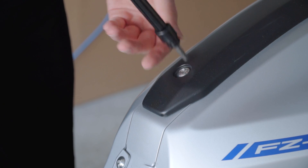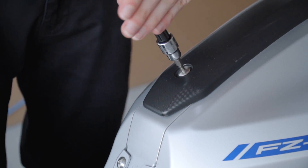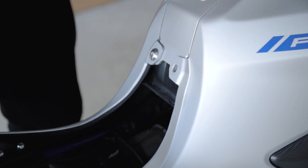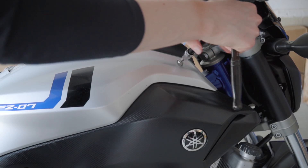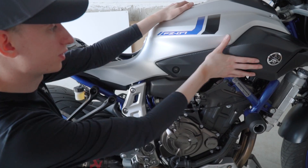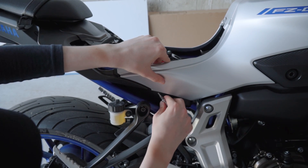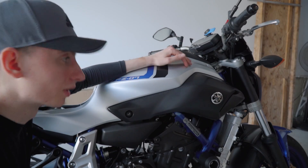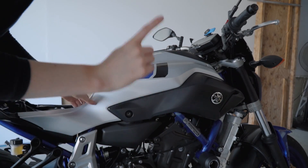We're gonna remove the bolt on the tank which is too small for this socket. Don't lose this washer right here. Now don't just start yanking on this panel because it won't come off — there's one more thing. There is actually a small tab right underneath this plastic right here; all you have to do is just press it in. There we go and it should pop right out. Now you can actually pry this panel off — be really careful because these plastic tabs might break really easily.